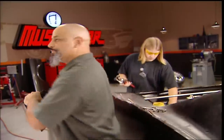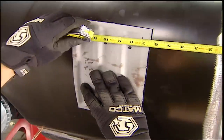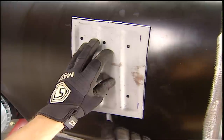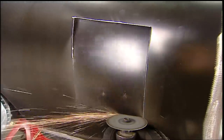Do you notice anything missing? It's louvers. The Le Mans came with louvers. We cut these from the original quarters because you can't buy them either. We also measured their location using the door jambs and the rockers. Same theory as before — the better the cuts, the less fab work needed.